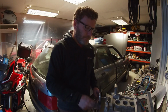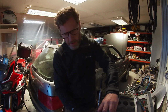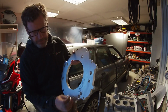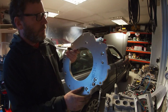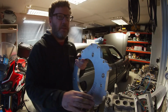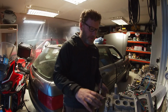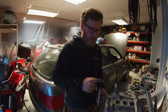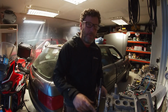One last thing I have to do here is what I showed you in the video there. We just countersunk these fellas here so the bolts, when we bolt up to the motor, are all flush, so there's no interference with the bell housing. But one last thing we need to do as well is tap the threaded mounts out on the motor. It's an M10 thread, but it's a slightly different angle of the pitch. I can't remember the name, somebody will know out there.